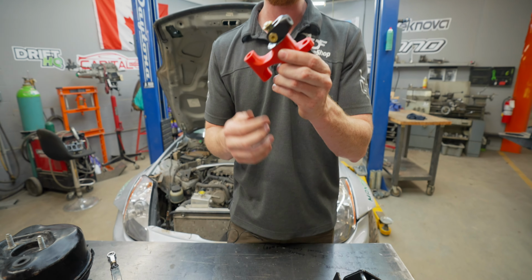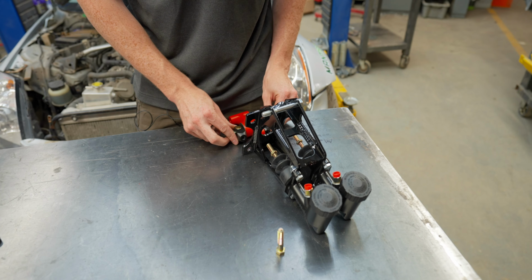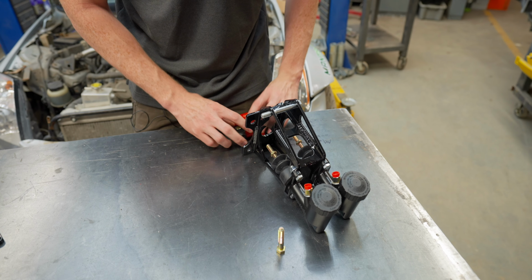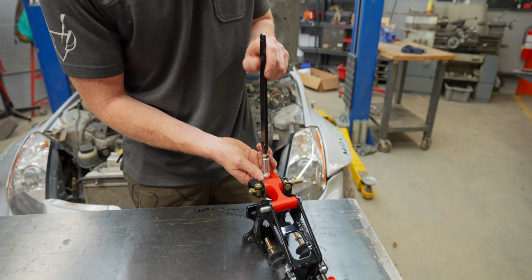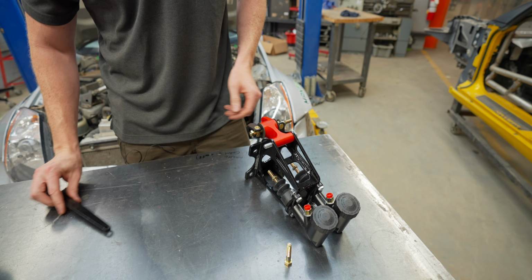So when you think of this assembly installed here, it's going to allow us to apply pressure on these two master cylinders by moving the bearing more to the left or more to the right. It's going to pivot from this fulcrum point, and then we're going to receive the input from the brake here, and that's how this system works. And that's how I am able to mechanically bias my car.